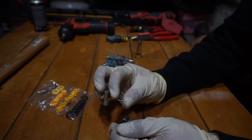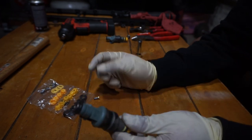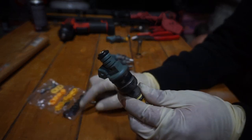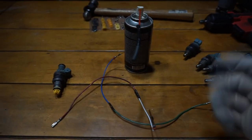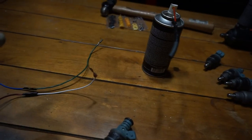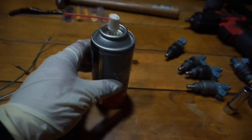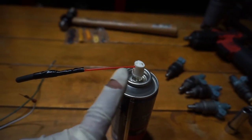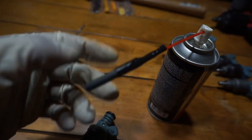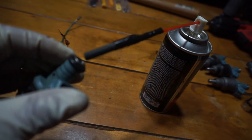Leave the filter out for now because I'm going to show you how to clean the injector so it's nice and clean on the inside. You don't want the filter filtering out the cleaner going through the injector. All you're going to need is two wires, a power source — in my case a car battery — and some carb cleaner or throttle body cleaner. It comes with a little straw, and I taped a small hose to the end of it which will go inside the injector.